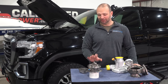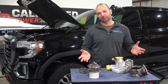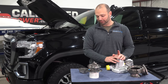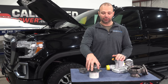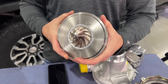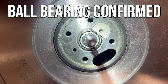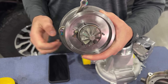It's a single turbocharger, right on top of the motor, on the passenger side of the engine. It is a Garrett — looks about a GT20, GT22 frame size, so it's bigger than the turbocharger that was on the 2.8 liter. We're looking at stock about a 42.3 millimeter compressor. It's a six blade compressor — pretty cool compressor wheel. It's got a coating on it which I haven't seen before from anything on GM's lineup. It looks like a ball bearing unit.